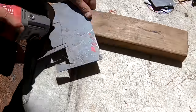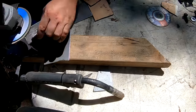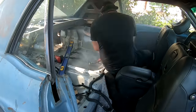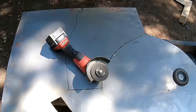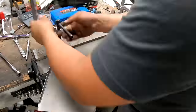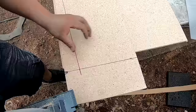Now we're moving on to the interior. Oscar's working on pieces of pretty thick steel to box in the frame reinforcement so we can tie in the roll cage — you've got to have a roll cage on a car like this because you can't rely on the body in a rollover. You need an inner skeleton you can rely on in the event of a crash. He built those two pieces and then accidentally broke a window — he was trying to hammer out a dent in the back and broke the rear window glass.